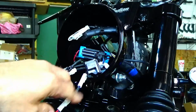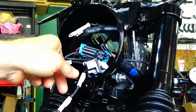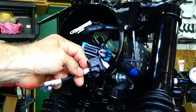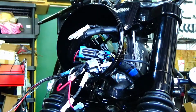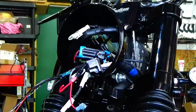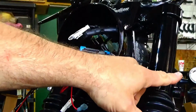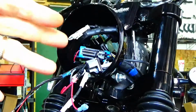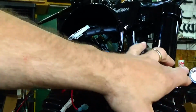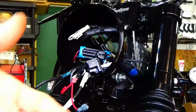And basically, the problem with the Scouts is when you have a typical motorcycle turn signal wire, you normally have what would be 2 ground wires going into the actual signal itself. Then when you flip the blinker on, the flasher, you're going to get a 12-volt pulse to the trigger wire in the light, which is going to give you your amber turn signals. So it's like ground, pulse, 12 volts, pulse, 12 volts, pulse, 12 volts, and that's your flashing.